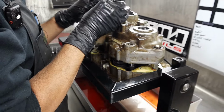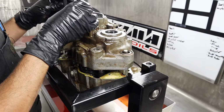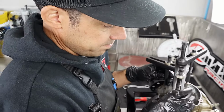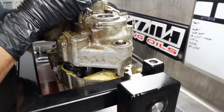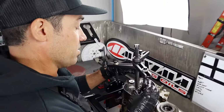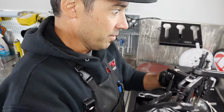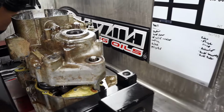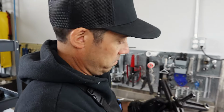Take this out and just lift it and go slow because there's washers in there, guys. I know from experience. The tranny shafts, those washers, you can make a mistake and forget which one went where. So look at the parts finder. I've done that before. It didn't want to shift into third, fourth gear. It was uncool. Night before a race?